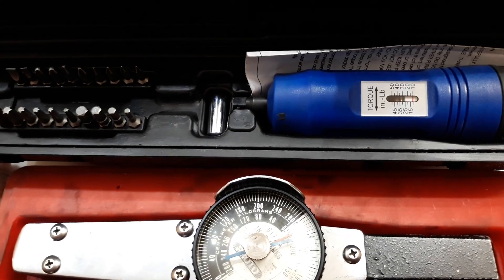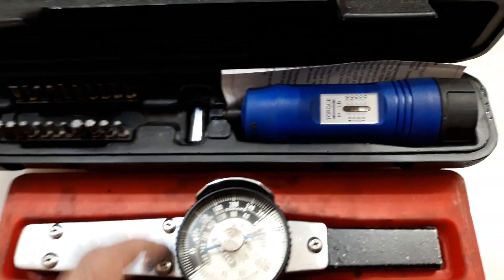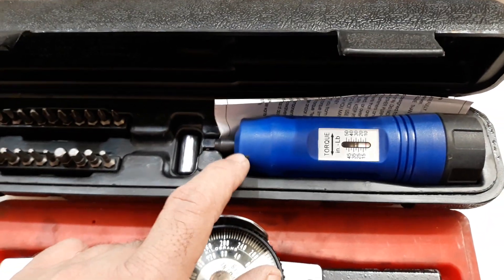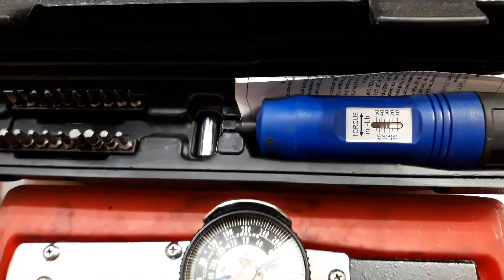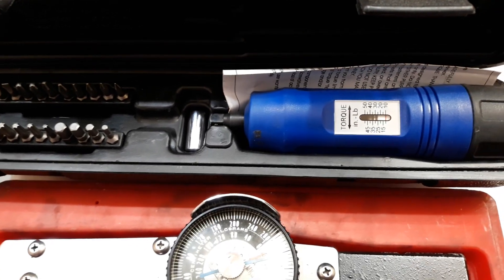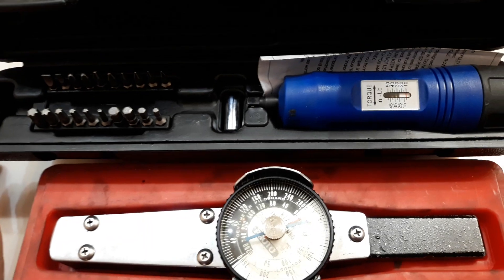Flat rate is gun-and-run — but that's a different topic. I thought I'd show you something I think everybody should have, especially if you're in diesel. This Proto is pretty expensive; this Stark set varies in price and you can find them pretty cheap on Amazon. Right now I'm using them for injectors, air filter housings, and ECM connectors. When I leave a unit, if someone calls and says I stripped something, I can say no — I used this tool at this torque spec on that date. Then I ask them how they torqued it, and normally they don't have either of these tools and are just going by feel.